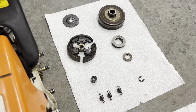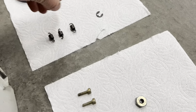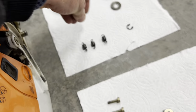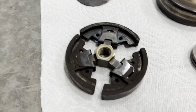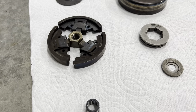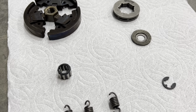Why did my clutch springs kill themselves? I think this needle-bearing cage had given up — I've got the old one and it doesn't have any needle bearings in it. I think one of those got bound in the assembly, which threw those springs off. So I cleaned the clutch up, ran some parts cleaner on it — it honestly looked fine, and the local parts supplier agreed it didn't need replacing.